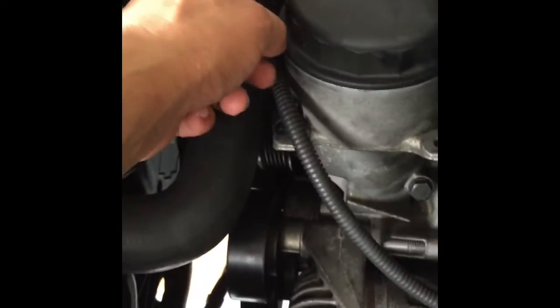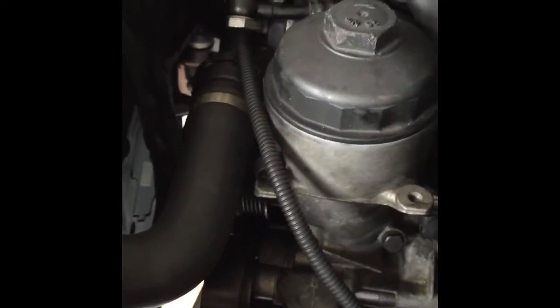I put the electrical connections back to normal. I also put the vanos back on — make sure that's tied down well so it doesn't leak. Put the oil filter back on, then install the serpentine belt by releasing the tensioner pulley slightly to get it back on, and then put the AC belt back on. That should be pretty much it.